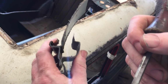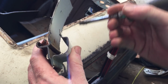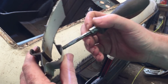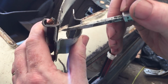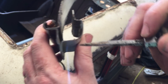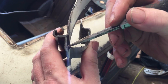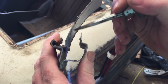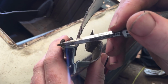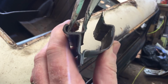So yeah, here's a section of the roof that I've just talked about. You've got this inner section, inside the car, where the roof lining mounts to and clips into. Later Minis have actually got holes where the bars go into, but in principle that's what that is. You've then got this bit, which is the side of the car. The original ones have got all the rear quarters and even the A panels in, but that goes around the car. And then you've got the roof skin itself, which lands into the gutter, so you recognise the gutter there. This basically comes across and it finishes just there, you can just see that.